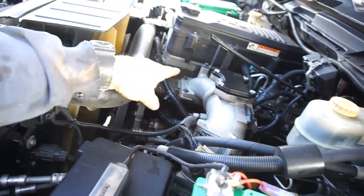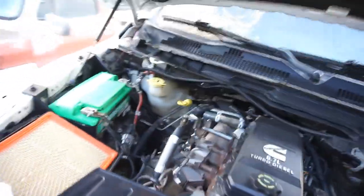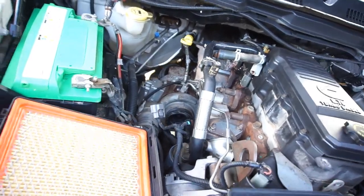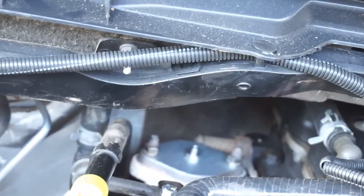Here's all the EGR components — drilled off. I do have one of these coming like I said, so for the meantime I'm just gonna use a blocker plate. Gotta put my dipstick back in. All this stuff just fell off. You can see back there I do have the EGT adapter in there and the probe sitting on the bench.